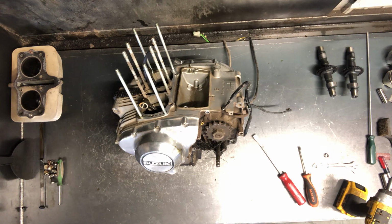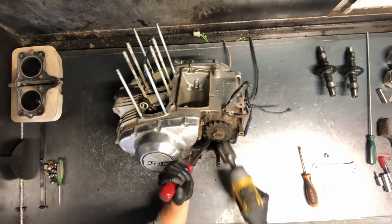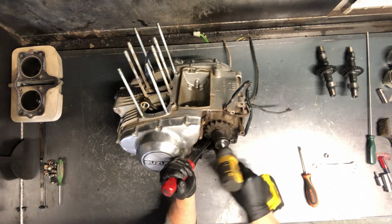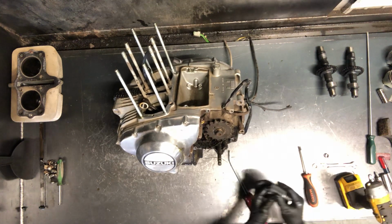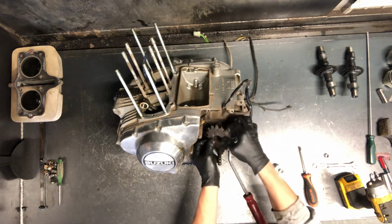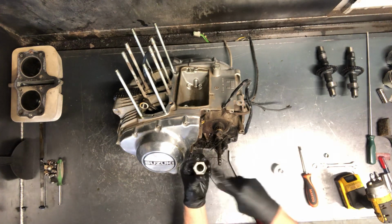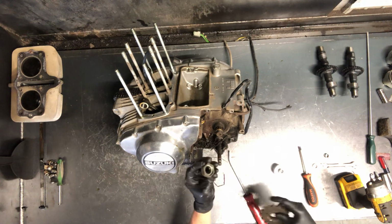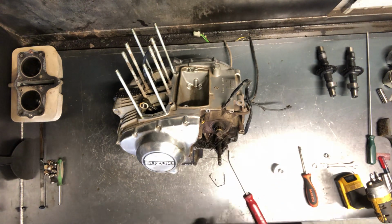We're going to try to do it without spinning that sprocket there. So you can stick something down there. You do not want this to spin if you have something stuck in there. So just be really careful, you got a good hold on it. That nut is off, then you're able just to pull that countershaft sprocket, replace it if need be. Make sure going back together that that nut is going in the correct direction. Grooved goes in, kind of holds that sprocket on the splines there.